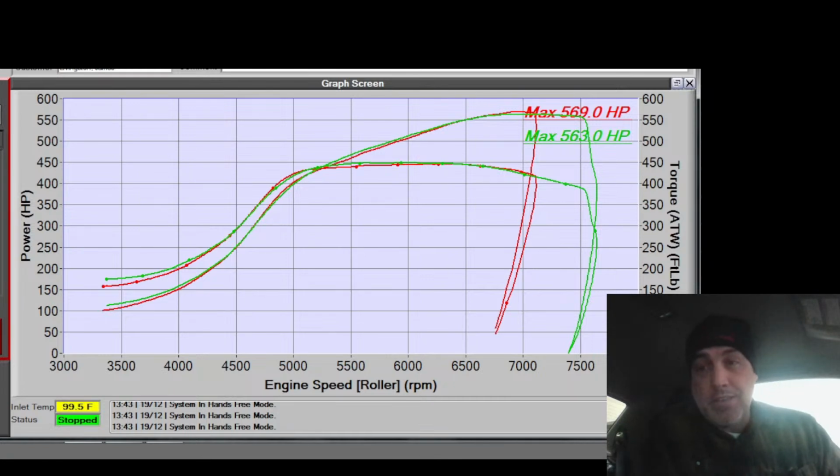Again, you know, it could kill the turbo faster over time. But if you're tuning a G series turbo, it is important to know that it will trick you. You will be way past the maximum tip speed on the turbo, and it'll still be pushing air and making power. So that's just something to keep in mind. It's important that you do that.